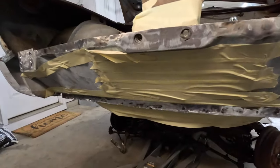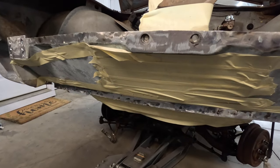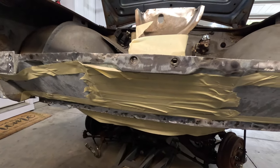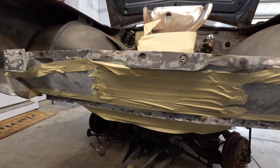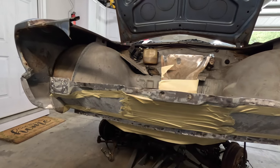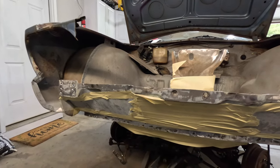I've masked off the areas where I'm going to put on some weld-through primer on where the new metal is going to weld onto the body. I covered up the zinc grip and the ink stamp there because I like it, and I like knowing that it's there. Who knows — maybe in 50 or 100 years, if this car is still around and needs some front-end rust repair done, someone else will get to discover what I did. Let me get some weld-through primer on the bare metal, and then we can punch some holes for our spot welds and finally hang the new nose on and get it welded in place.